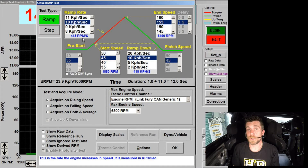What I quite often do, particularly on an engine making a lot of power being driven very hard, is after finishing my main tuning with a normal realistic ramp rate, I'll do one or two runs with a much longer ramp rate. This gives the engine a much harder time on the dyno — more load for longer. If the engine doesn't suffer from knock during that really long high-load ramp run, I can be relatively sure that when I release the car onto the road or racetrack, it's going to be safe under worst-case conditions in the real world.